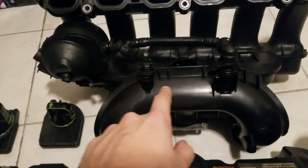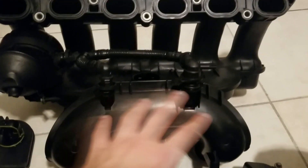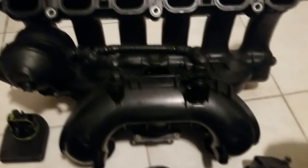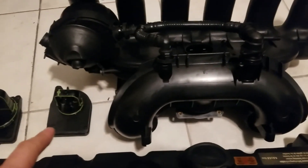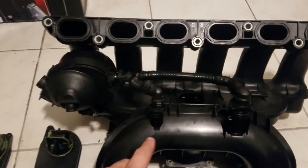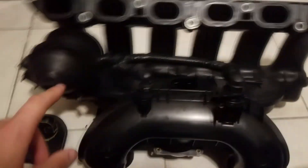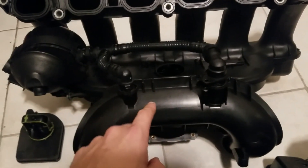You'll have that same setup, so it will be plug-and-play. If it's a dual-port from stock on your car, then it's easy — you just get a dual-port manifold. This one, as a matter of fact, came from a 2007 530, which has the metal valve cover, which is why it came with the outside oil separator. So if you have a 325 that's stock dual-port, it's plug-and-play to a dual-port manifold.